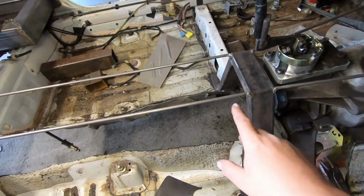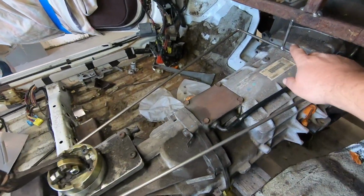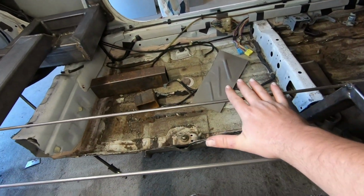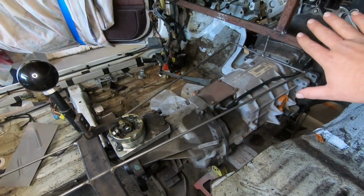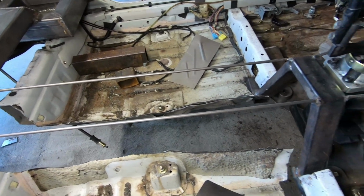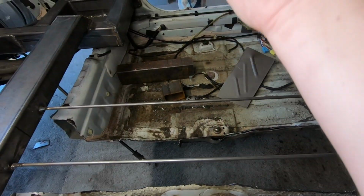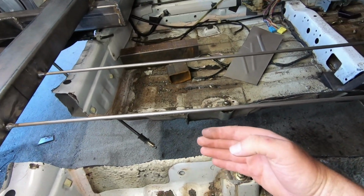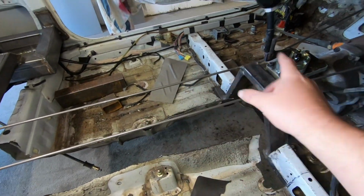So I built this out in one of my videos before, kind of just got this little framing structure going on. This is just to hold this frame piece out right here. So I'm going to go ahead and build and use these to figure out a plate to go right here, a plate to go right there, a plate to go upwards. And once I make this top plate, I'm going to have to put some angles on it, and those angles can't be too long because the press is not actually going to allow you to put a piece in there, make one angle that's way up, because the metal itself will bind up with the press. So I'm just going to have small angles off there, then another piece to come off it, and let's just get these tops drawn out, placed in, and then go from there.